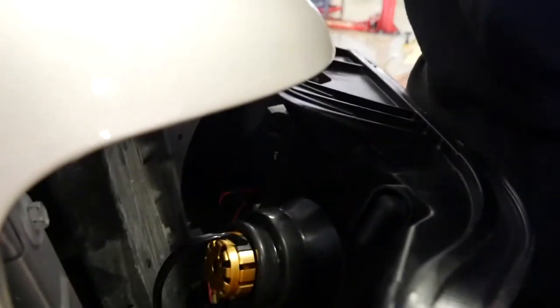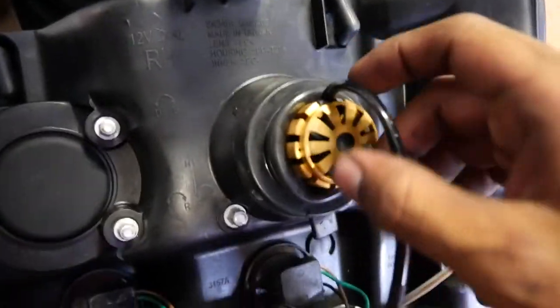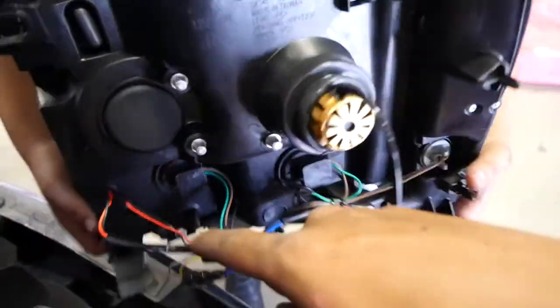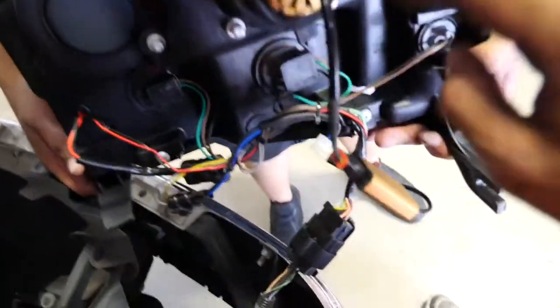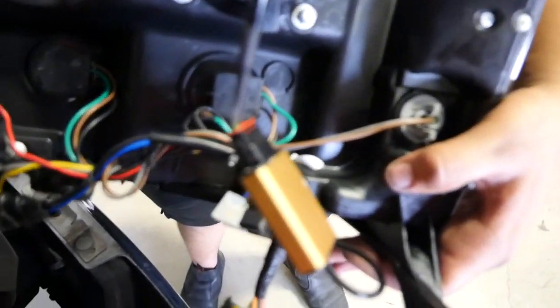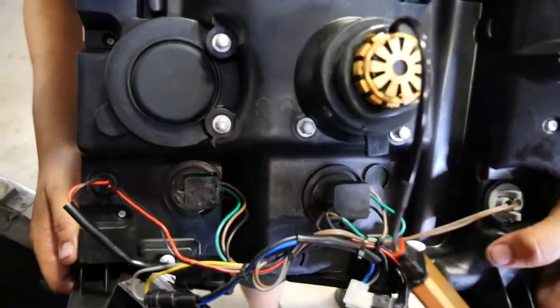So I'm going to show you how to wire them. As you can see I cut it out - I just made a little X, pushed the wire through. This wire is always outside and I ran it to here, then tied in the U-bar or the light that goes on the outside to the running lights. The wire for that one is gonna be the gray and green wire. The LED headlight has that weatherstripping I put in it so water doesn't get inside.